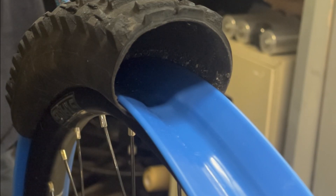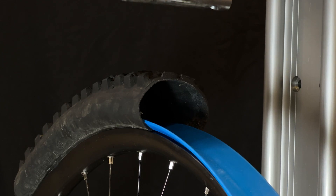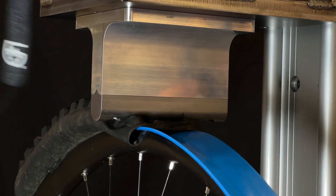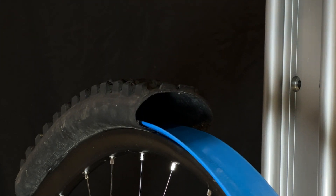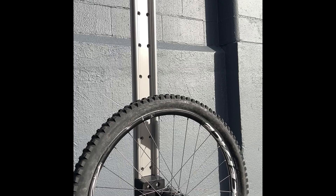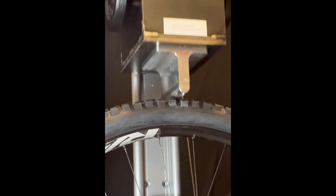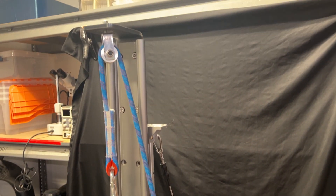So the question becomes: can you just not put a tire on there and do your impact testing? Well, not really, because the tire does change how the rim breaks. What we ended up doing was cutting a tire and putting it right over the impact spot. For tests with no tire insert, you glue the tire in place. When there is an insert, usually the insert can hold the tire and bead into the right spot for impact. The damage we saw from that setup was virtually identical to what we were seeing with an inflated tubeless tire. Obviously the energy values are different, but if you're using the same tire pressure between different tests, the tire does absorb some energy — but the goal here is to compare an insert with no insert.